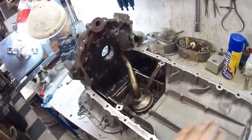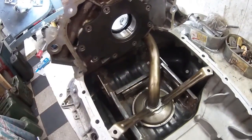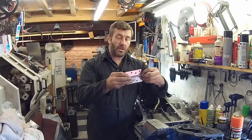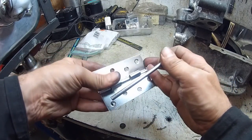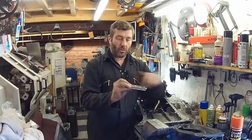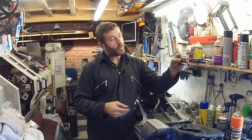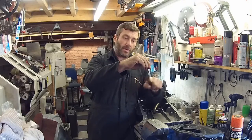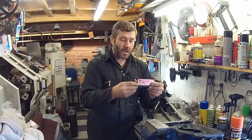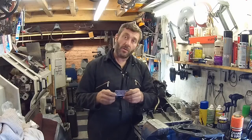This is the standard 1UZ sump aluminium casting. I've put the oil pump on the front — here's the oil pickup pipe — and looking down into it, this is the standard oil pan. The easiest thing to do is get some loose pin hinges from your local hardware store. These make excellent trapdoors without having to mess around making hinges from scratch — they're all nice and free. The only snag is that the hinges have holes in them, so all you do is weld up the holes. We'll make some steel baffle plates to go on the left, right, and front of the oil pickup, weld these trapdoors on the inside, and then oil can flow in toward the pickup area but can't flow out. It's a simple idea — just a bit of steel fabrication.